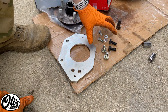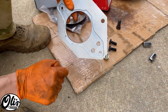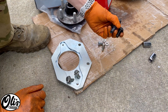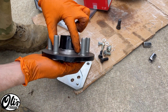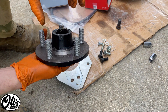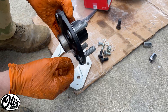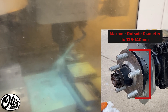Let's talk about what actually comes in the kit when you purchase it from Epitech. You're going to get one of these really nice adapters — Epitech right there, as you can see. The next thing is these two bolts that go right here. Then you'll have a longer and a shorter bolt with some washers, plus two more that are used for mounting your caliper. Finally, the last thing in the kit is this ring, which I already have installed on my hub — it's the centering ring for the brake rotor when we place it on the hub, since the diameter of the brake rotor is larger than the hub. You can also purchase an Epitech kit with rear hubs already included, but I elected not to do that.